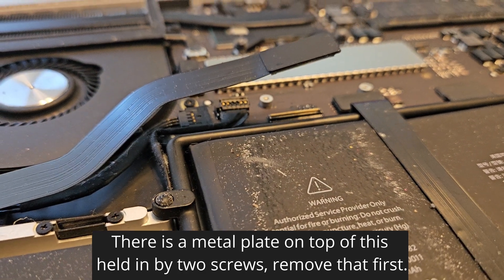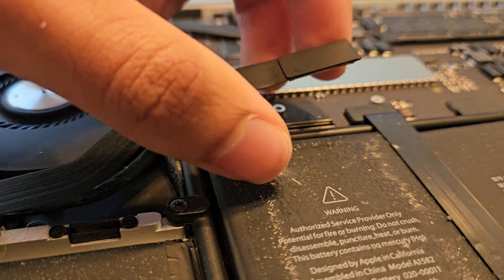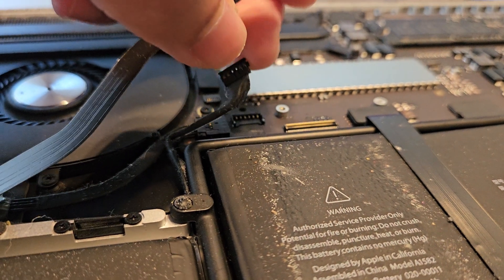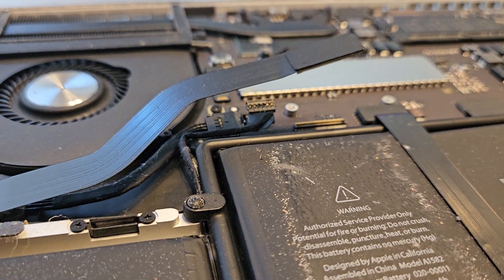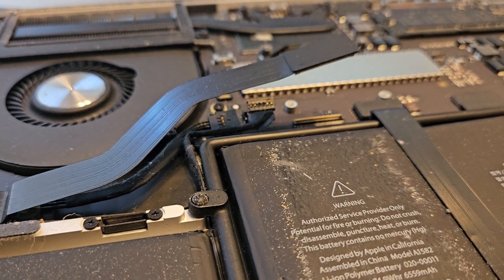To the middle left of the laptop there's a long ribbon cable that clips in right next to the trackpad cable. You're just going to want to pry that off slowly and carefully. Once that's pulled off, underneath there's another clip for the speaker — pull that up. It's held to the side of the battery frame with some light adhesive, so slowly and gently pull that off.